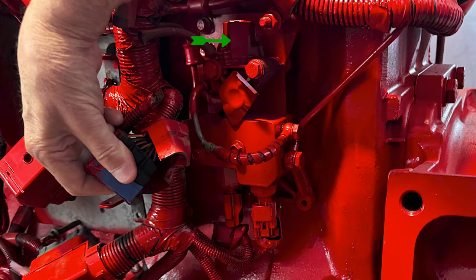This is an air solenoid that will send truck air pressure down this line into that housing to clean all the fuel out of that housing through that line — the same line that goes to the injector behind the turbo — so that no fuel is in that injector, to stop it from carboning up.